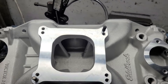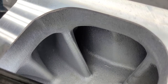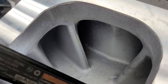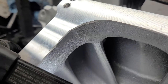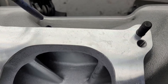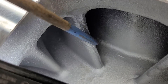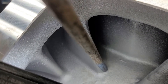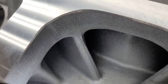We love shiny right guys - shiny makes fast. Let's see if we can get some light on this thing. Overall I like the design - not a tremendous amount different than the Chevy Victor Jr, if you pay attention. What usually happens is your inside short ports probably flow a little bit extra, so what they do is put a sharp edge here on this divider - that's not by accident, guys.